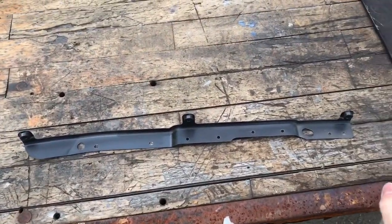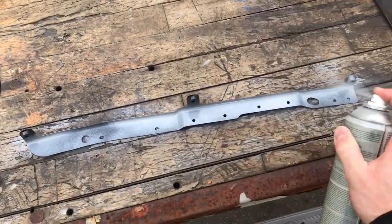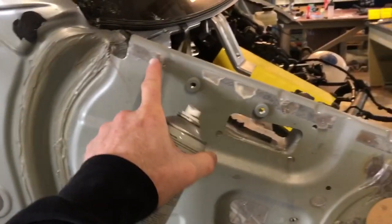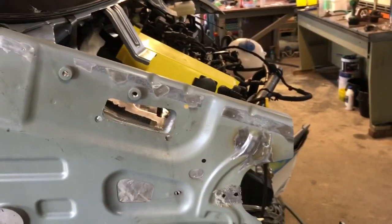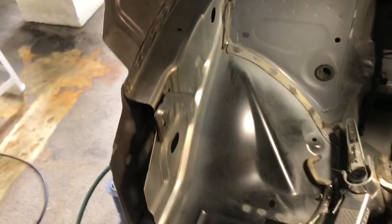What I'm doing now is really important. On the back side of all the parts I weld on, I put this special welding primer. That helps it not rust so easily. On the new part there, this one has original black primer from the factory, so that's not so important. But here on the chassis where I've been sanding down the old welds and we're gonna weld the new holes — here it's really important to have the primer, because on the back side you're not gonna be able to paint later. The first light coat dries a little bit, then I can do one more. I do this underneath or between all the new parts I weld on.